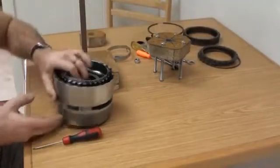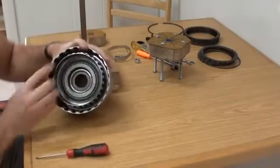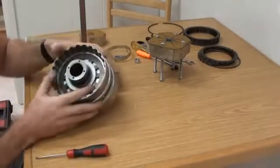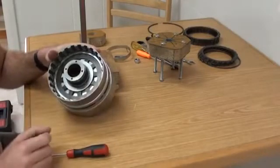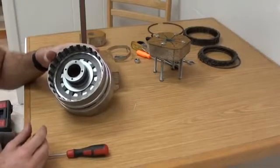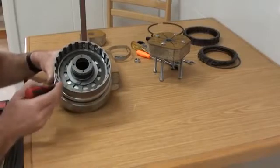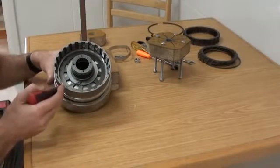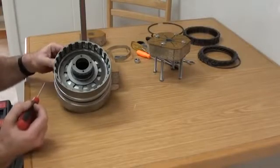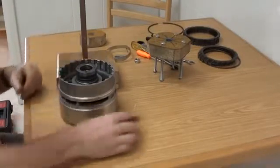For that reason you can see on this side the normal cup spring, but also on the other side underneath the freewheel there's actually another spring there as well. So when you compress the cup spring on this side, you actually need to compress it twice as far and there's considerably more force than with the other clutches, simply because you're compressing two of those springs. Also what makes it more difficult is there's a circlip in here that instead of normal stop rings, is a single piece of spring steel — and that's a little bit difficult to remove.